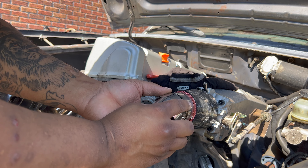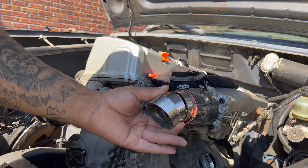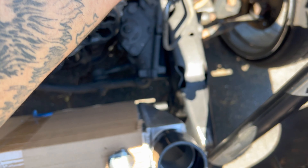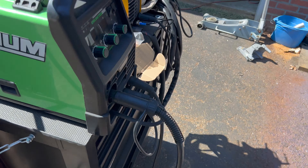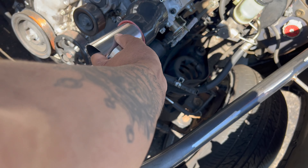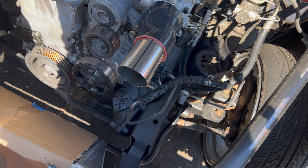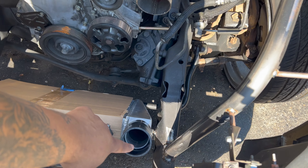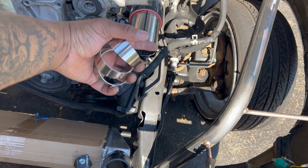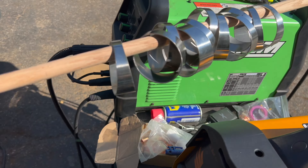After it's all lined up it'll come out of the manifold like this — you can see the angle pitching down. So the first piece I cut will go in here like this, cut it down, it'll come down, and then I can start my 15 degrees from here coming out, then just put whatever straight piece is needed in the middle.